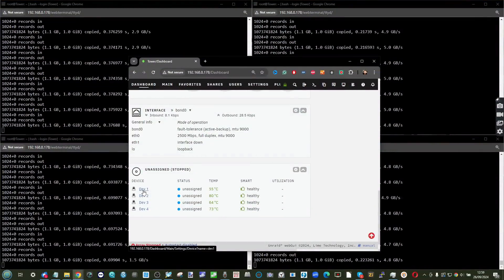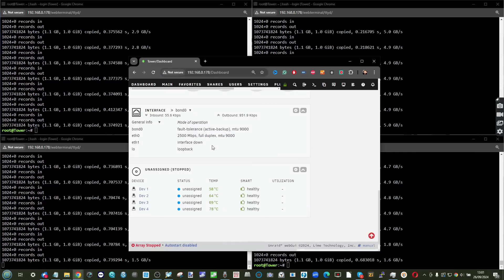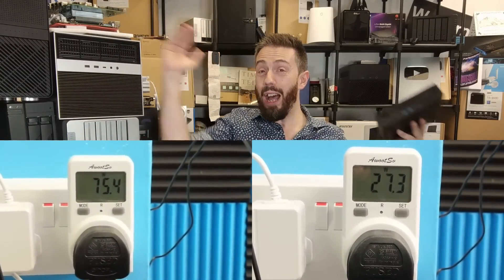On temperature: with 500 individual write operations happening on all four SSDs simultaneously plus the CPU under load, the peak temperature we saw was 79–80°C on the 4x4 slot. That is technically throttle point for an SSD, but keep in mind that was an incredibly unrealistic test, and that SSD didn't reach that point until the very end of 500 consecutive 1GB write operations. With all that going on, staying under 36–40 dBA was impressive. Power consumption with the 8700G only peaked at 75–77W during that extreme test.